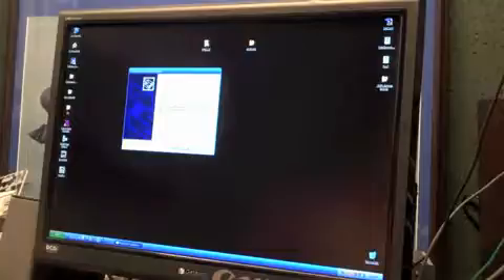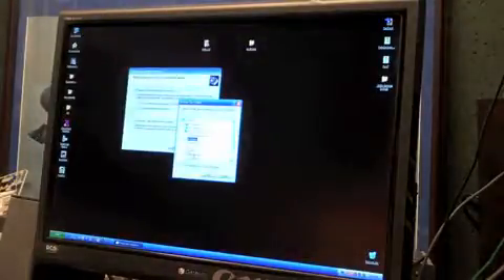So what I'm going to do — the new hardware wizard comes up and it says, do you want to search for the proper update, blah blah blah. Say no. And say next. Install from a list of specified location. And then I go ahead and just browse to that location, which is on my desktop in the PC drivers I386 folder.